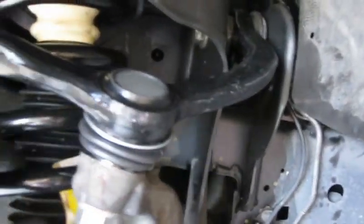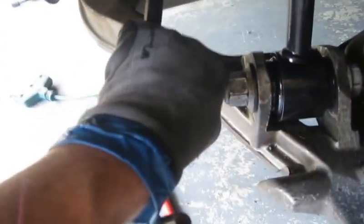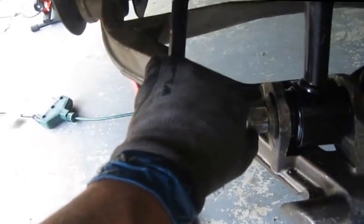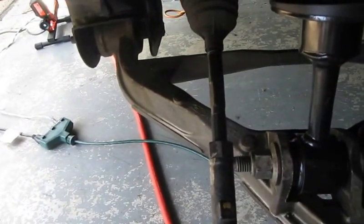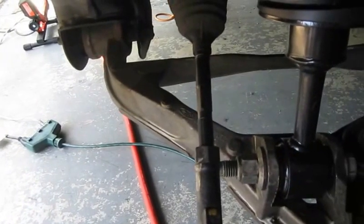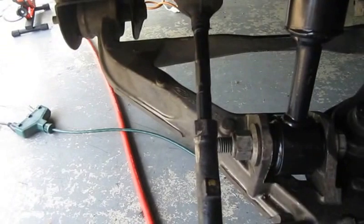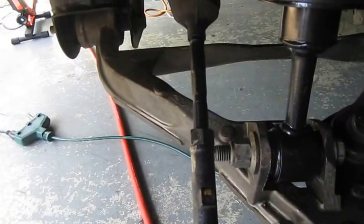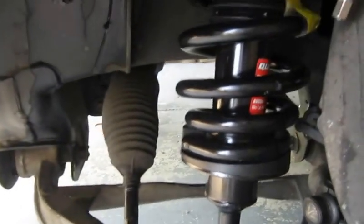On the driver's side, I've got the upper control arm and the strut on now. This big nut down here goes to almost 300 foot-pound torque, and I went as hard as I could, jumping up and down on it, and I don't know that I ever made the thing click. So I put thread lock on it — I hope I got it tight enough. I did what I could do and I'll just have to keep an eye on it.